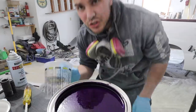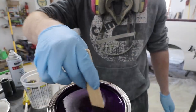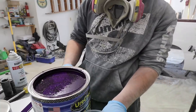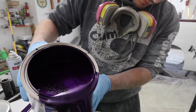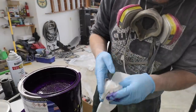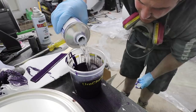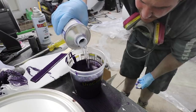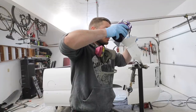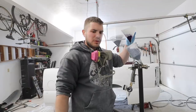It's unreal. So the mix on this is 2-1. Scrape the bottom, get the pigments all stirred up. This is a lot of paint, holy crap. That's just about perfect, but it's also everywhere else. But in the cup, this is already pretty thin, so I'm kind of amazed at how thin they want this, really. That should be a good starting point, guys.